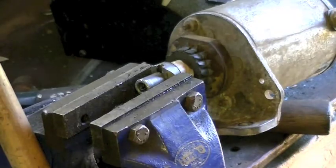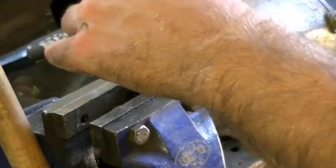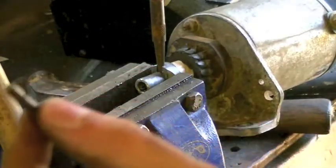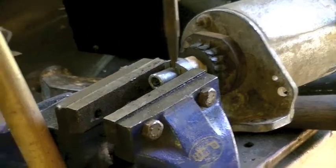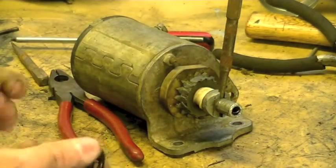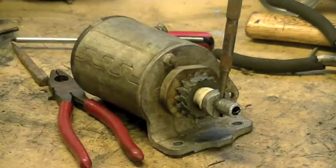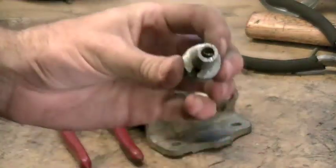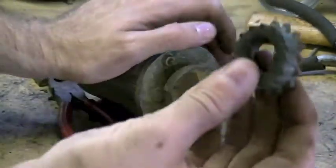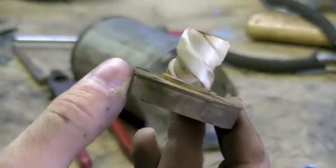That pin gave a hell of a time getting it out. The solution was to clamp the shaft in the vise and use a punch to drive it out — and there goes the roll pin. It's worth noting that the cage and spring were removed during the process; the cage just broke apart and fell off, but you get a new one with the kit. Off comes the metal shaft, a washer, and the broken starter gear. This spline shaft assembly is known as the Bendix — when the starter spins, it launches upward and engages into the flywheel gear.